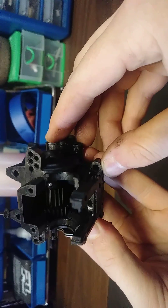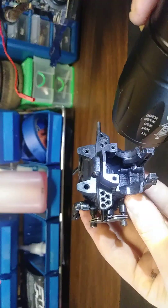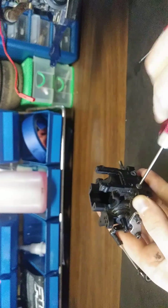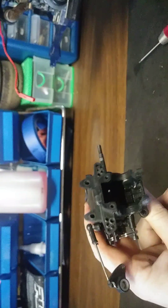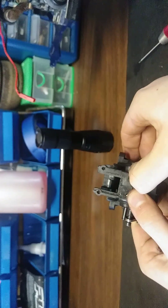If they're poking through, they could be hitting gears and causing damage. You can see with the flashlight that I've poked through on one, so I'll have to loosen that up. You really just want to make sure these bolts are flush. If you get this brand new you probably won't punch through it, but if you've bought a used Jato it's very possible. You can try using shorter bolts, but be careful you don't lose enough thread engagement and have it pull apart.